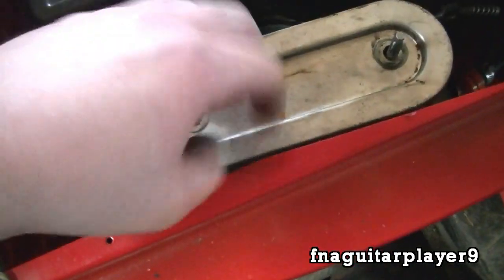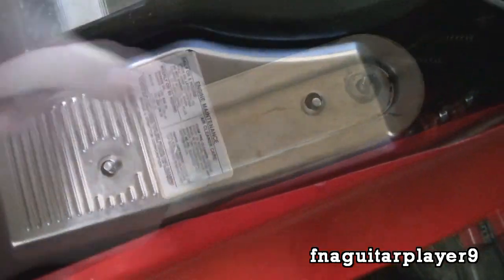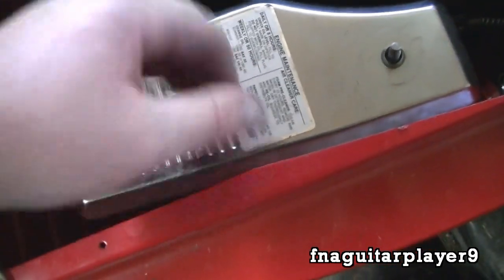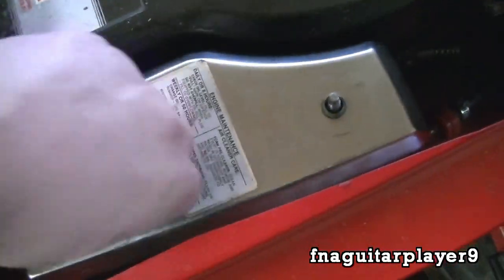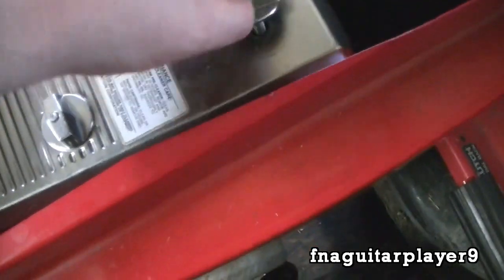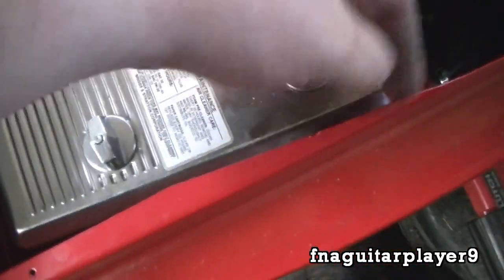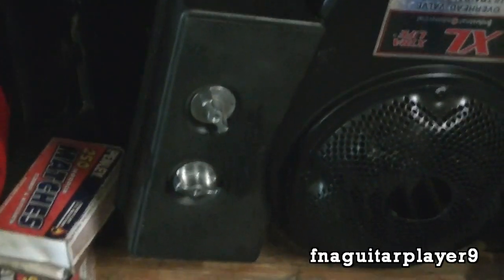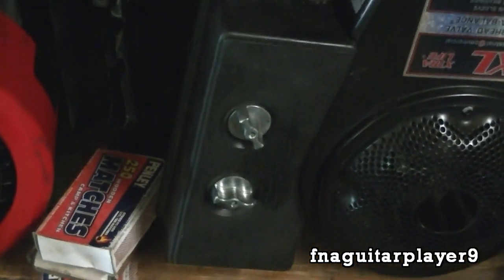After cleaning, or if you decide to replace it, just put it back on and put these two nuts on. I always like these chrome air filters — these breathers. They look real nice. I'll show you a couple more other styles of breathers. Tecumseh usually has a style like that — you just take the two wing nuts off and it's basically the same. And for older-style Briggs, you just take out the two screws and you have a foam filter inside.